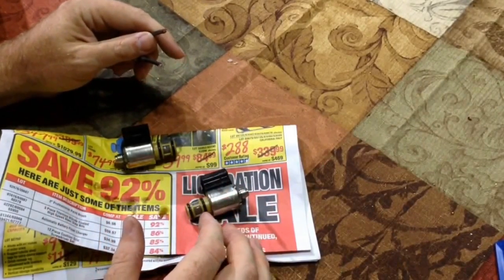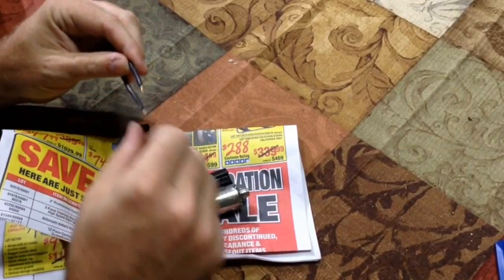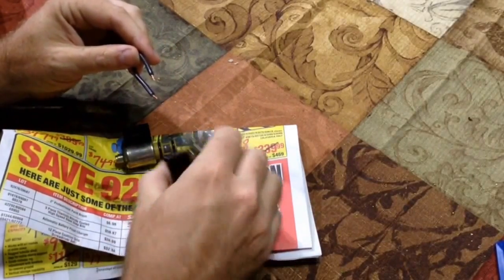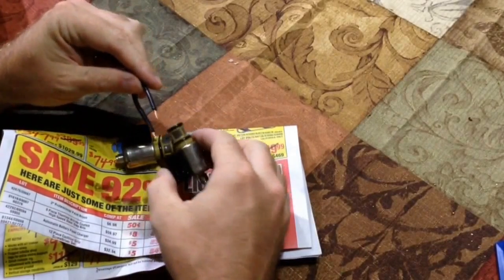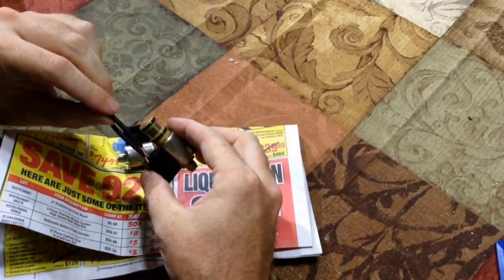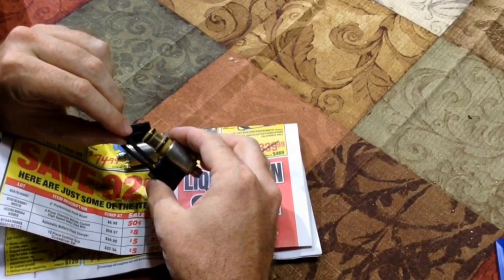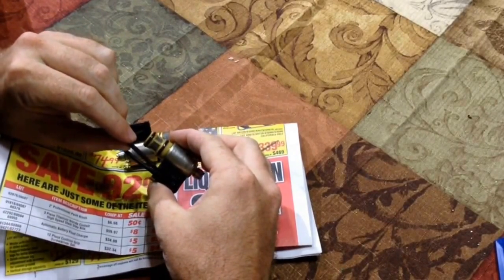This is not going to flow rate them, obviously. Like you're probably going to say, you can't tell by that. Well, you can tell if they're totally shot, and that's about it. You can't tell if they're flowing right. And we're going to get down in there, these 2 little pegs. We're going to touch the wire on that one, and we should be able to hear it click.